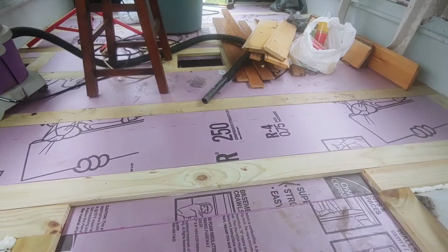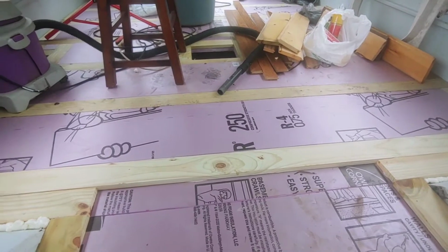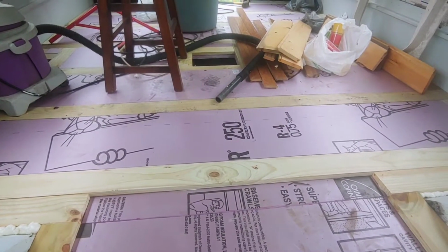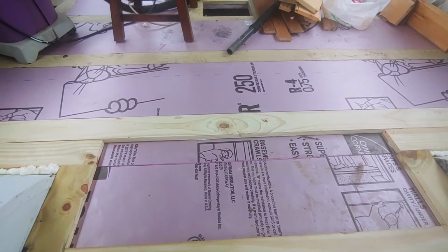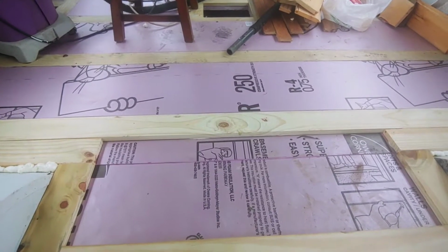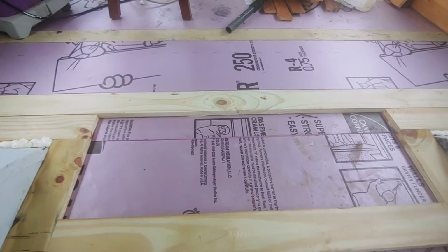I had polyacrylic, that's it, I always forget the name of that, on the bottom of my maple boards. So I haven't done anything with the tops, and what I'm going to do is first install them, sand it all level down, and then finish it. So anyway, everything under here should be water resistant.